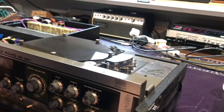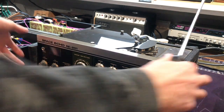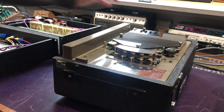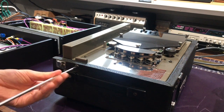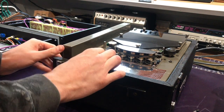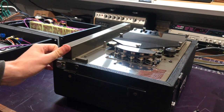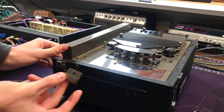Set it back down flat again. Once you've done the screws on the bottom, you're on to these little brackets on the side - and another over on this side - so you can start unscrewing them. Sometimes this little section can be a little sticky, so you just press your thumb on there and kind of pull the case away. It'll unstick and slide straight out.